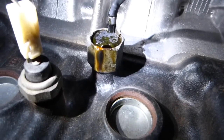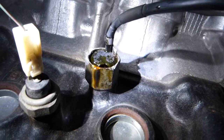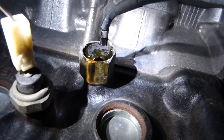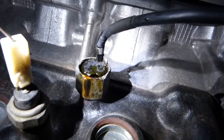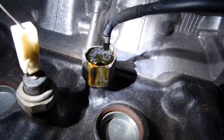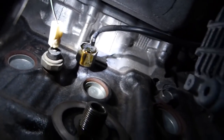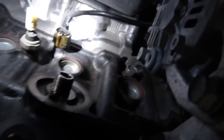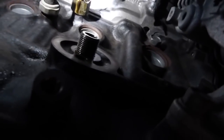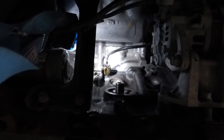These sensors are miserable to access. That brown discoloration on the knock sensor is some kind of resin that this microphone is coated with — that's how it comes from the factory. The overflow of resin dripping down is not normal, but that's how this one was assembled. Access to these sensors is somewhat limited. You can see the oil filter is missing from the engine, the drive shaft is missing further down, and then there's the exhaust pipe, the frame, wheel, and ground. So that's the access to these sensors, where they are, and what they do.